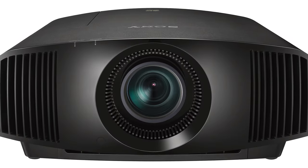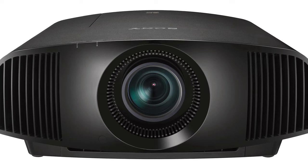Front projectors cannot even get close, with most able to produce light output in the range of maybe 100 to 200 nits. The result on a front projector is a super dark picture that is not even close to what the video producer intended us to see. Most people with traditional projectors have found themselves constantly turning up the brightness and contrast to counteract how dark their HDR content is. This leads to a suboptimal picture, but also really way over-brightens SDR content. Or you might set up your projector somewhere in the middle, but then both your HDR and SDR content suffers.